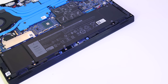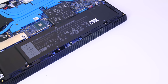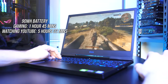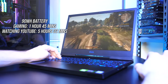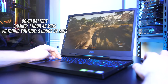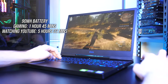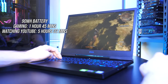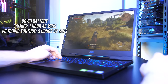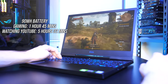It was using the Intel integrated graphics thanks to Nvidia Optimus. While playing The Witcher 3 with medium settings and Nvidia's battery boost set to 30 FPS the battery lasted for 2 hours and 16 minutes, however after an hour and 45 minutes it had 19% remaining and the frame rate dipped down to 13 FPS and wasn't really playable anymore. I suspect this would be less problematic playing less demanding games, but even so this is one of the best results for this test I've had out of all laptops, again thanks to that large battery. Expect lower results with the 60Wh variant.